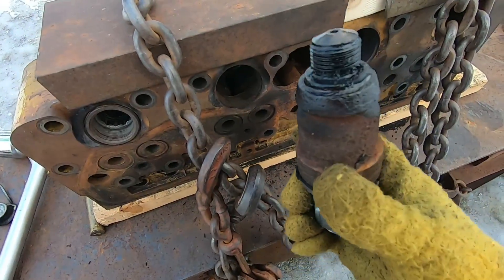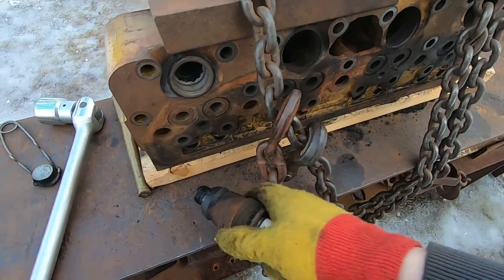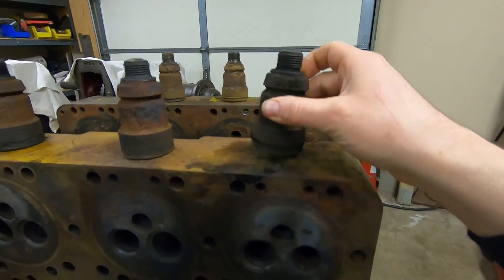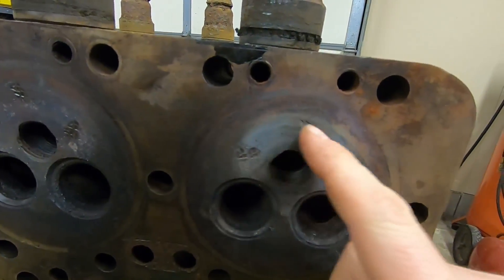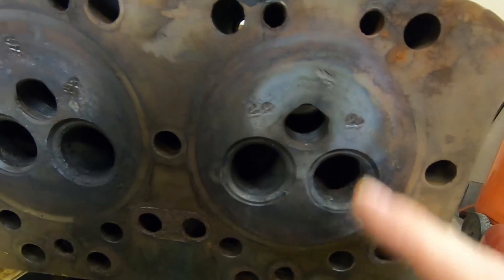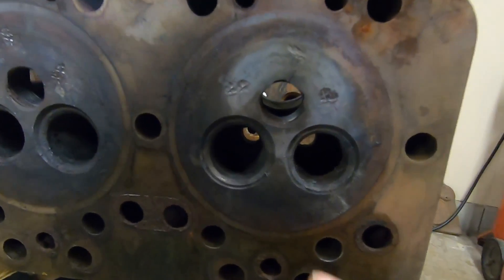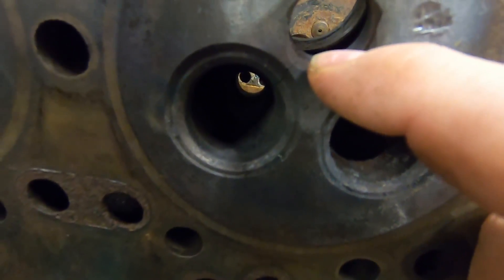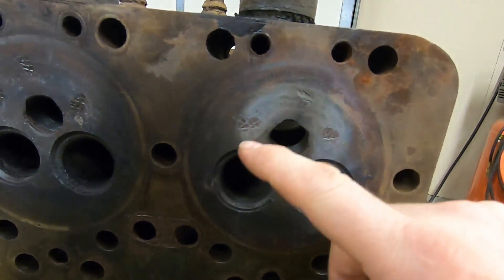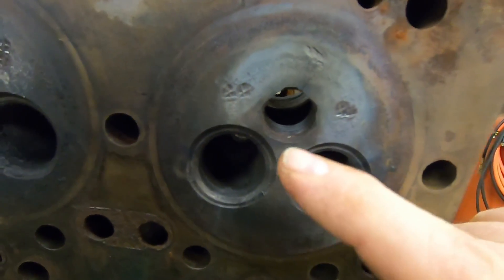That's three out, still got one left. I've put like a day into this thing and I've only got three of them out. Number four was actually the worst one. We got it out and seemed to have salvaged it, but we had to heat this head so hot so many times — I think we put it through three heat and cool cycles. We were even striking the surrounding metal with a punch and a hammer. We'd already written this head off. It was only about salvaging those chambers. We actually cracked it on one of the cooldowns through the pre-combustion chamber bore and through the valve bore. We thought that would have loosened its grip, but still no go. We did another cherry red heat and finally got another crack to form, and it finally relinquished its grasp on number four chamber.